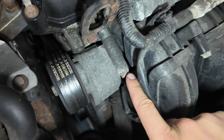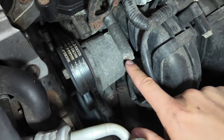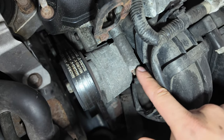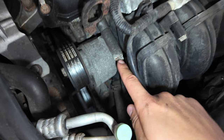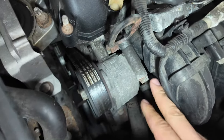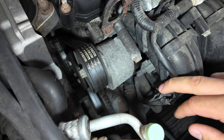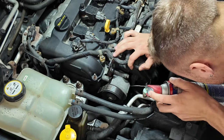You can see on my car we've got some rust in the engine bay. Because it's in the engine bay we should be okay for a while, but we want to address that corrosion. I'm going to put some penetrating oil like WD-40 on all the bolts we'll need to remove, just to prevent snapping them — that's what we're going to do.